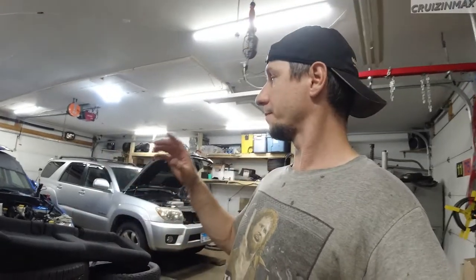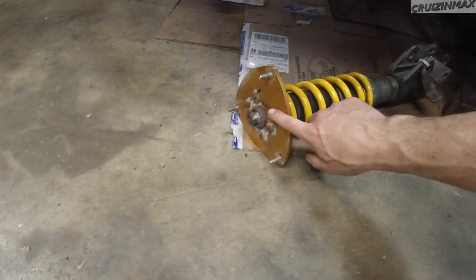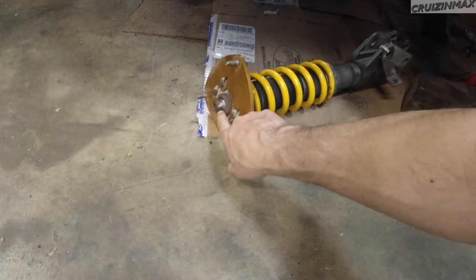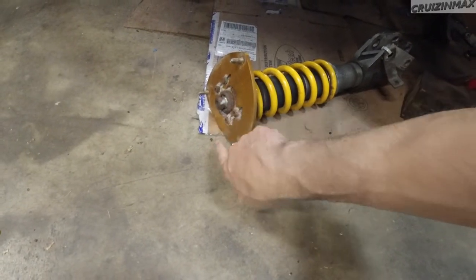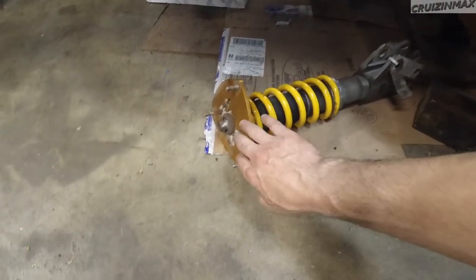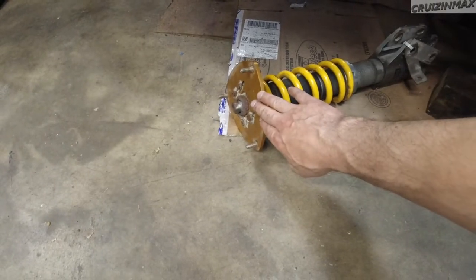Next up, I think, is the engine. Well, we still gotta do the clutch and everything. I'm waiting on these camber plates. Cannot install these, as shown, because there's a lot of play right up in here. Okay, I need two hands to show you. There's play inside that ball, and these are replaceable. They are pricey. The rear ones, no camber plates on this vehicle, but from the looks of it, I think there's going to be plenty of negative camber in the back. But these are going to be adjustable.